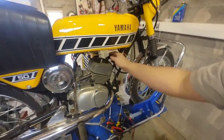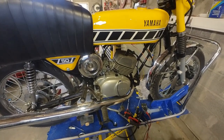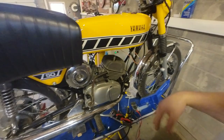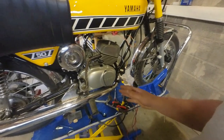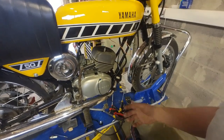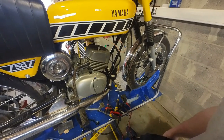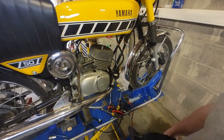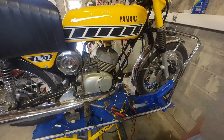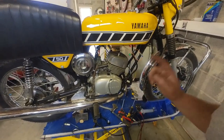That's my only way to stop it for now. I think at cold start the flywheel doesn't make enough rotations to get a good enough spark. I was struggling to get this thing started on a cold engine, and what I did is I used the drill on the flywheel to get a bigger spark because of the rotational speed - and then it just started. But on a cold engine kicking it by hand, I didn't get it to start. So we'll have to do some further investigations. I know there are some flywheel weights for this thing - maybe a heavier flywheel with more rotational mass would fix it. I'm going to let the engine cool down and try again, but we got this thing starting - this is awesome.